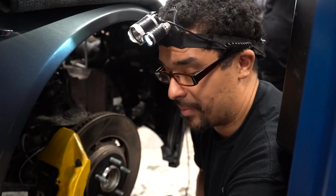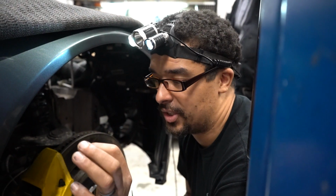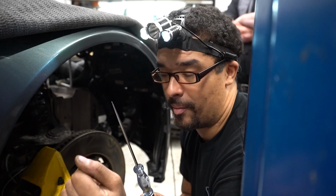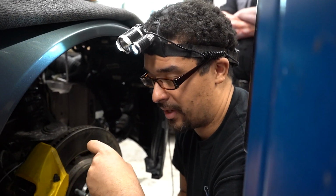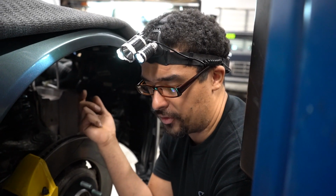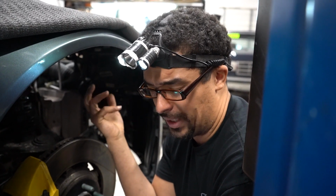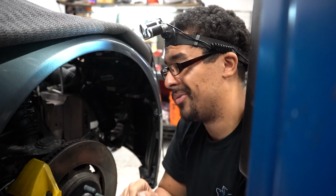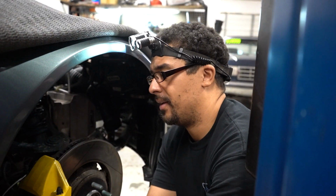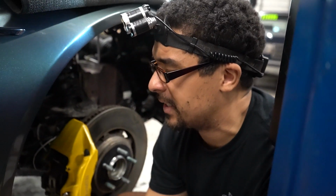The meter will pick up a ground because meters are looking for anything. Like if there's one strand of wire that's touching, that's good enough to make it go green. But one strand of wire could not light this up. So that ground from the case ground looks good. I'm not 100% certain why a ground to the ECU would be supplied as a relayed power. So I'm probably reading that wrong. If someone out there in internet land can school me on Aston Martin earth power grounds, I would appreciate it.